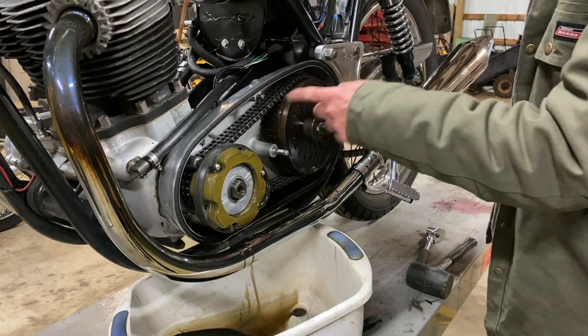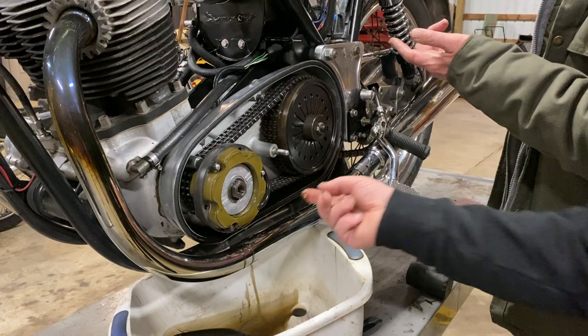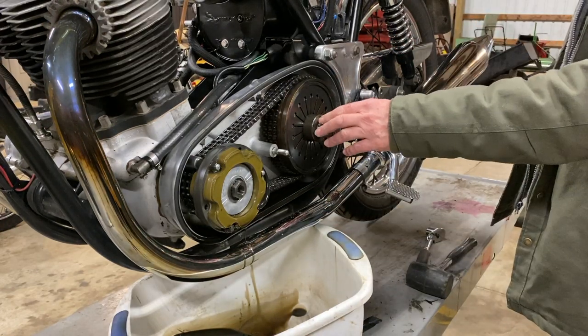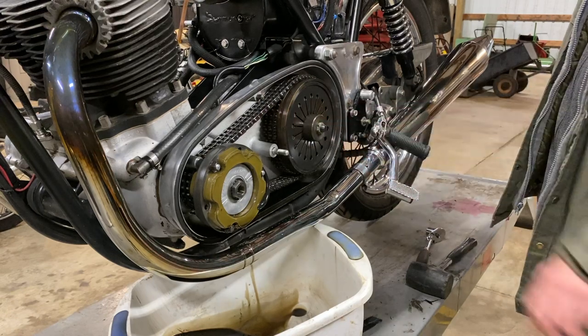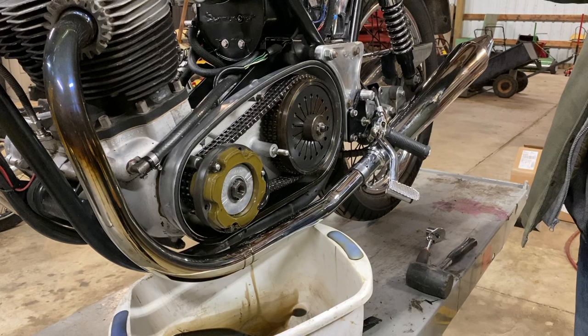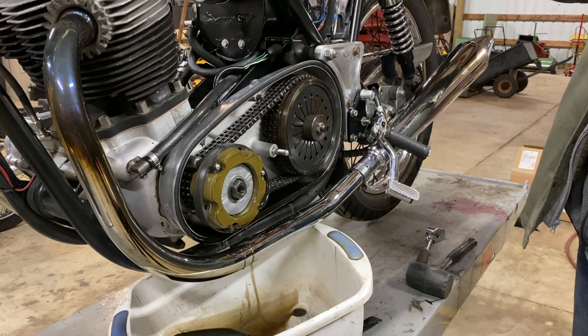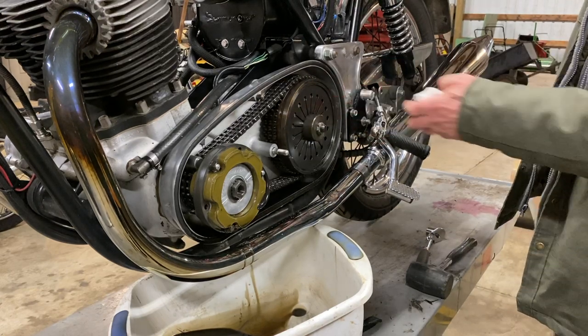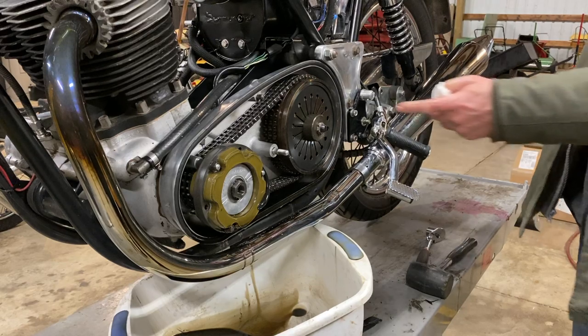This smells a bit, which I think normally happens — there's a bit of gearbox oil that's found its way in there. There's a mod, a seal you can get to prevent that from happening. It doesn't seem to have caused a problem with this bike, but on my other one the gearbox oil will contaminate the clutch plates. It comes through with the push rod.